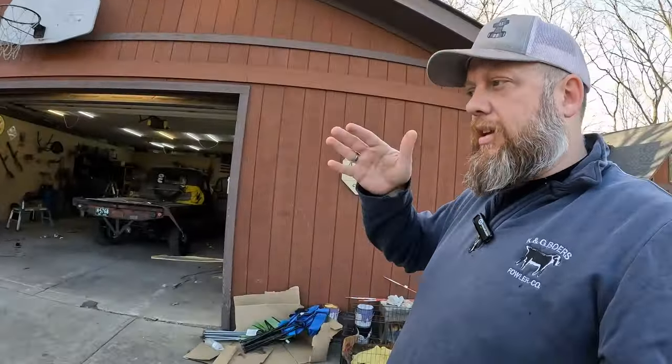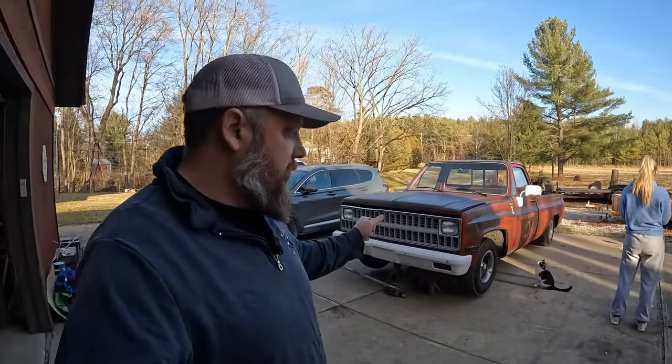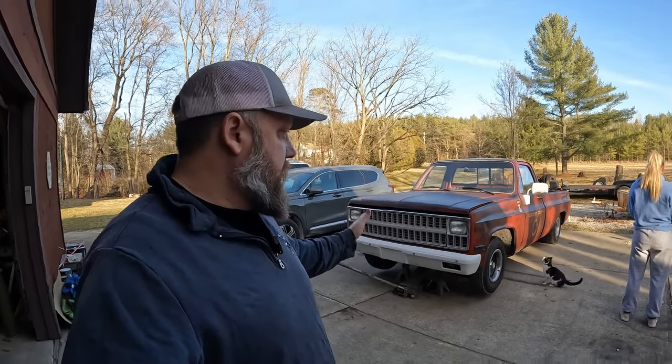And as you can also see, if you saw in that video, the flex plate is obviously not totally round. I showed it to a few guys who've been doing this longer than me. All of them said the same thing: that's not that bad. I've seen worse than that. There's probably no need to change it. Just shim your starter out a little bit further. So we're going to try that, see if we can finally get this thing functioning properly.